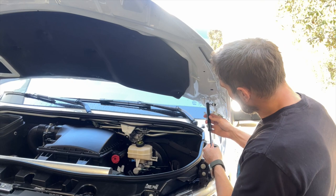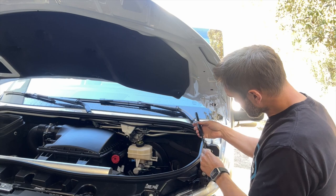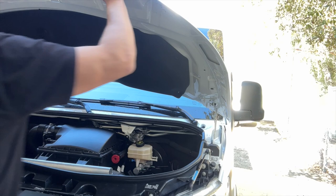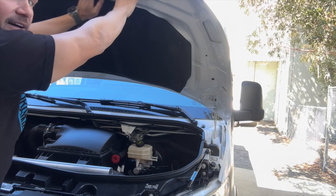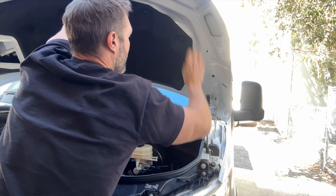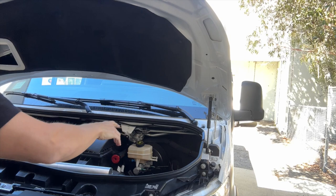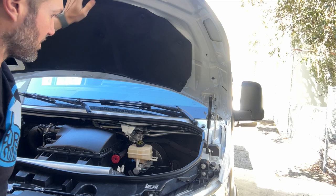For aesthetics, I usually put the larger barrel side up top, and I usually put the bottom one on first. You just press them on — pull it and now it's on the bottom. Then it's a little bit hard with one person, but you're going to want to take the hood and undo the far side so it can go all the way up. You'll actually need to stretch the hood up a fair amount to get this on. Just push the hood up and push with your other hand — it'll snap on. One strut is just at the very limit of holding the hood up, and it is holding it up right now, so that's a good thing.